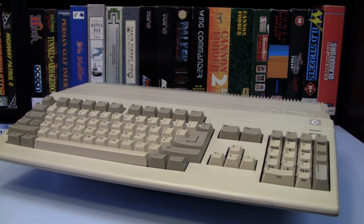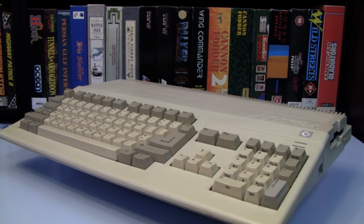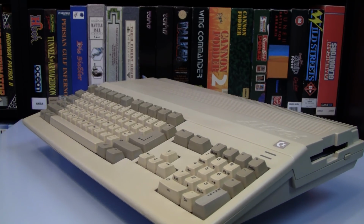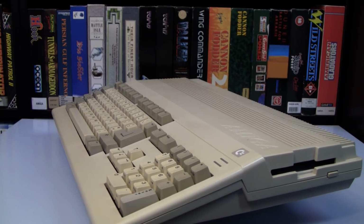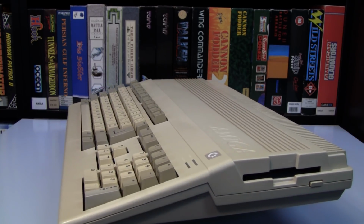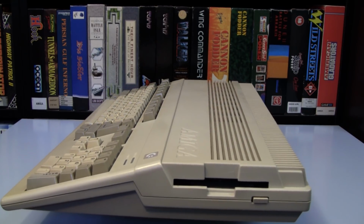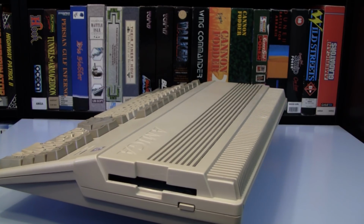Depending on the resolution, the Amiga can either display 16 or 32 colors simultaneously out of a color palette of 4096 colors. But with some tricks and special modes like for instance interlaced, overscan, extra half bright mode or hold and modify mode, the Amiga 500 can display even higher resolutions and/or more colors simultaneously.